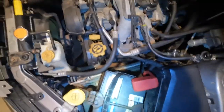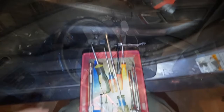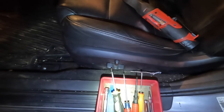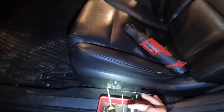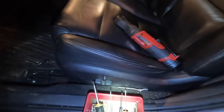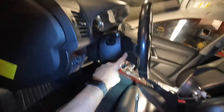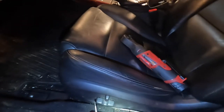Disconnect the battery, let it discharge for 30 seconds to a minute, step on the brake pedal, turn on some lights to drain that battery. Not too many tools needed for this job — a lot of Phillips, a 10mm socket, 12mm socket, 17mm for the steering wheel with maybe a little extension to get past the wheel, a Torx 30 bit (doesn't have to be tamper-proof) to loosen the airbag from the steering wheel, and a couple of flatheads and trim tools.